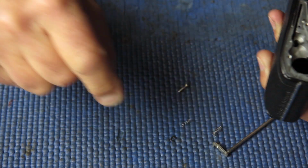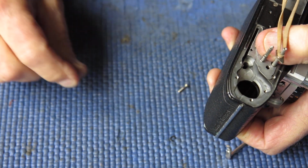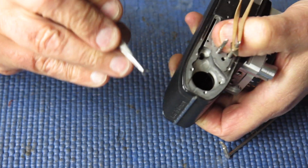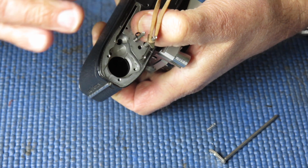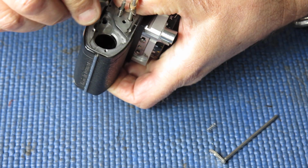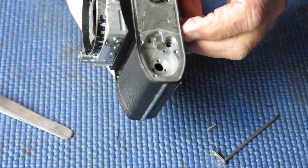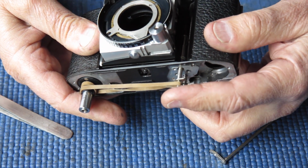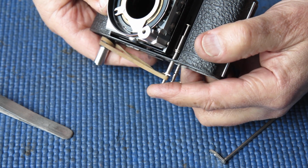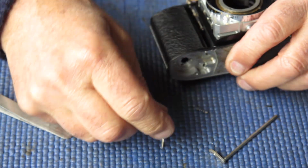At the top of the camera we need the spring. There are two springs. It was the lighter of the two springs. And I'm holding that spring down with my thumb below the slot that the circlip fits into, and I'll press that circlip into place. That lever is now correctly sitting in place. Now I've heard that shutter release shaft busy trying to get away there. I'd sort of touched that with my thumb and it took the opportunity to jump.